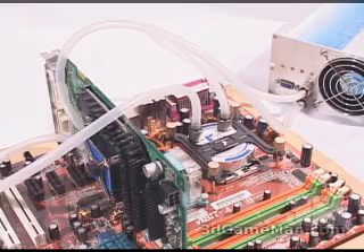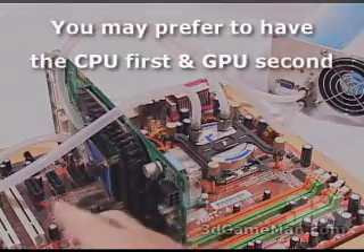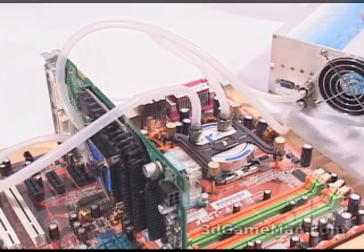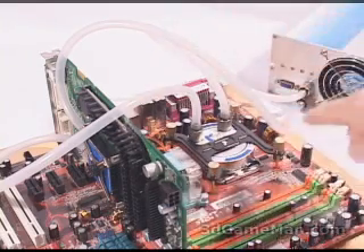Before connecting all the tubes, remember to cut them to length. It's recommended to connect the tubes before installation and run the system 12 to 24 hours to ensure there are no leaks. As per the user manual, the direction of flow is as follows: cool water from the main unit will first go into the GPU water block, then from there into the CPU water block, and then back into the main unit as warm water. Inside the main unit is a radiator, and with the help of fans, it will cool the water — and this cycle will continue over and over.